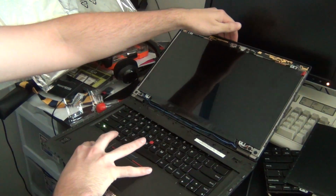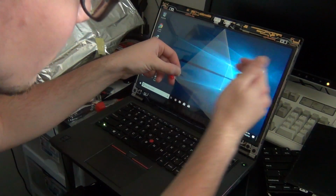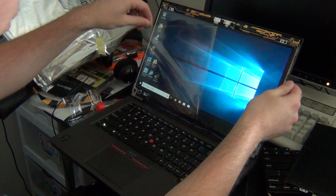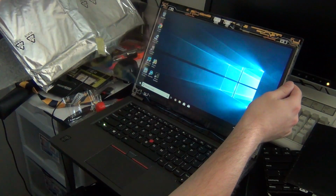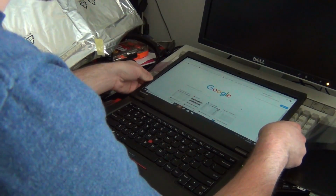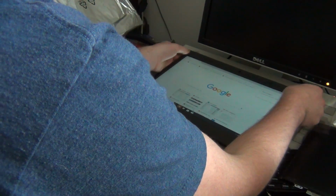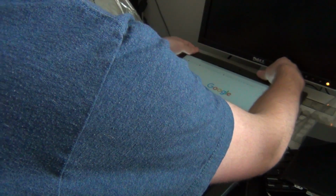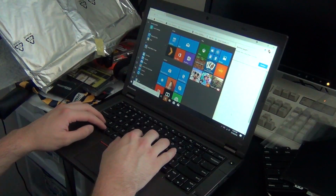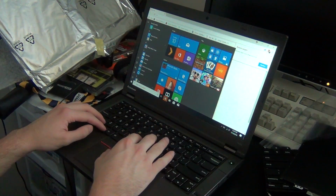Make sure your screws are securely tightened, and then remove the small film that's covering the screen during shipping. Then get the bezel and pop it back into place. Make sure all the snaps are secured properly, so that there aren't any unusual gaps in the display bezel. If all is well, then you've just upgraded your T440p to an IPS 1080p panel.